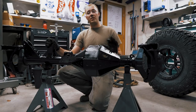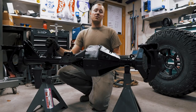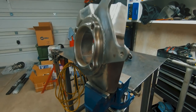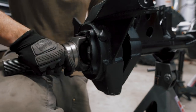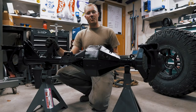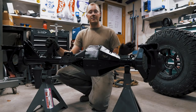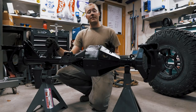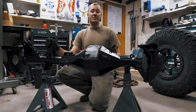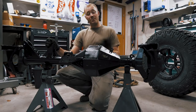On this episode we're finally gonna finish building the 609 axle. In a previous episode I already put together the high pinion 9-inch that we're gonna drop in here. Now I'm gonna put together the knuckles, install the axles, get the scene complete hub to hub. I'm gonna go over some of the pros and cons of building a custom axle like this and we're gonna weigh this thing at the very end to see if I was close to my goal of getting it as light as a Dana 44.